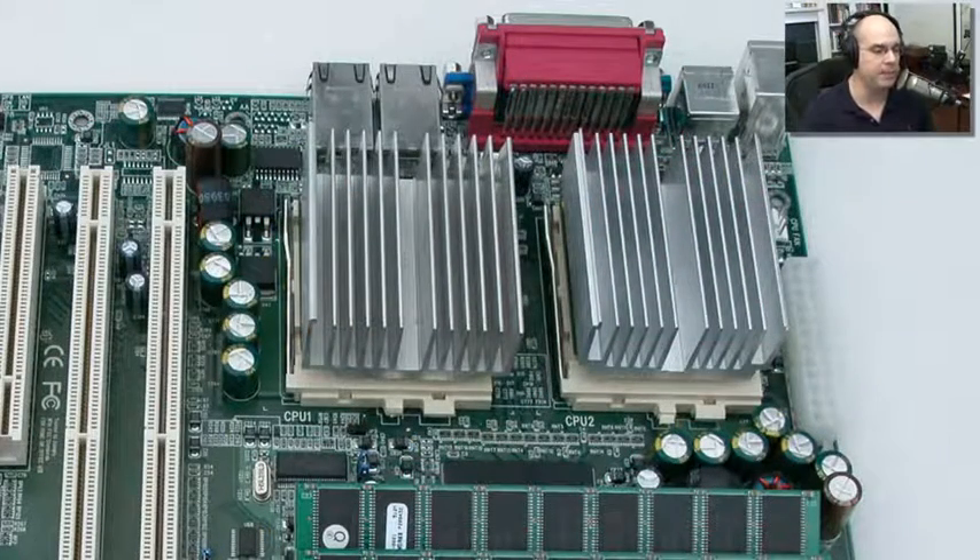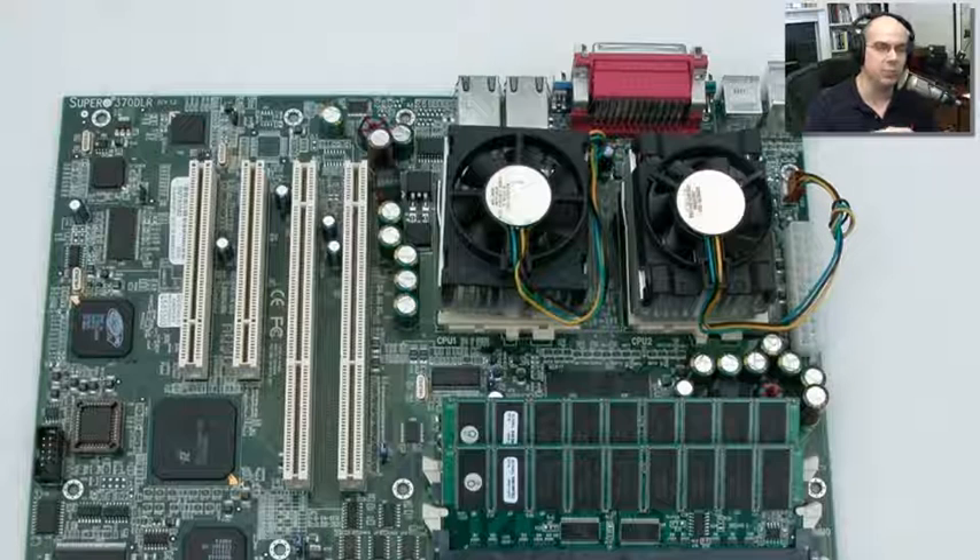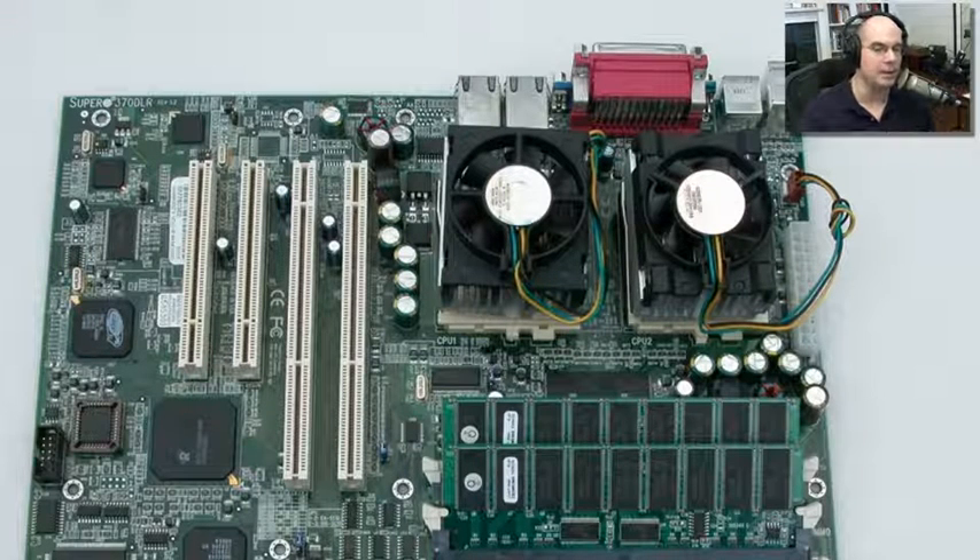Once that's in place, we can put the heat sink in place. Usually there are some metal straps that will connect it quite tightly to the processor components on your motherboard, connecting your heat sink directly on top of those processors. These particular processors get pretty hot, so we have more than just a heat sink — we actually have fans that we place right on top of them as well. The fans are powered with little power connectors right next to the processors on the motherboard, and they clip exactly on top of these particular heat sinks, coming as one component.